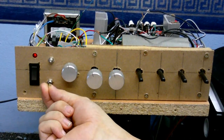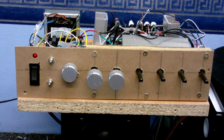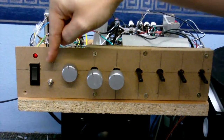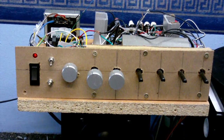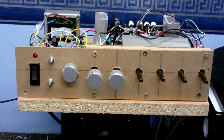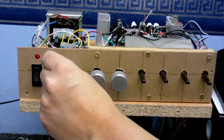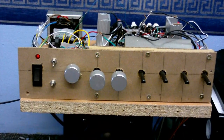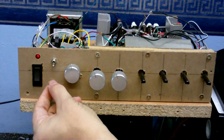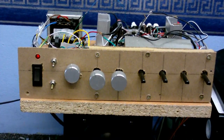Now if I flip this switch, we'll hear from the reel-to-reel. You can go back to the record by turning tape monitor on. So that's how that little thing works: tape monitor on, tape monitor off. And this switch selects which tape you want to listen to when the tape monitor is on. When it's up like that, that's reel-to-reel; when it's down like that, that's the cassette deck.